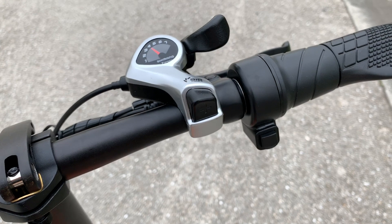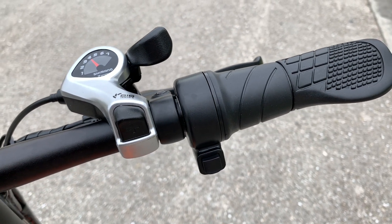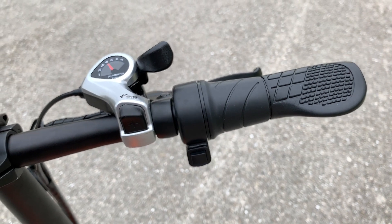With a half-twist or full-twist throttle, because the twist provides the modulation rather than a pushing motion, when your handlebars bounce you can maintain a more constant throttle. Half-twist and full-twist throttles are also sometimes better for people with arthritis or those who don't have good finger mobility, because you're using your entire hand to twist. With a half-twist throttle specifically, you can twist the throttle and then grip the rest of the handlebar with your other fingers, so you're not using your wrist muscles anymore.